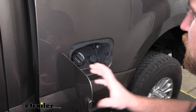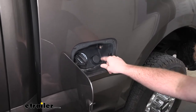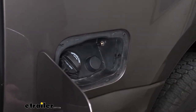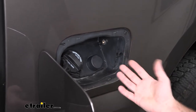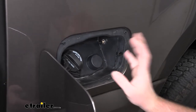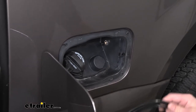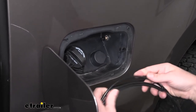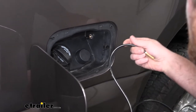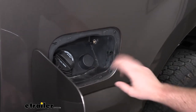Here we are behind our fuel filler door. I already have one side mounted — that's the passenger side — but we'll do the driver one together. Wherever you decide to mount this, if you're going to be drilling through stuff, make sure you're not going to drill into something important, and put these in a spot where the airline won't be bent super tight and kink. You need a little space behind there to have a good sweeping bend so you don't kink it, but there's a lot more room behind here than you think.